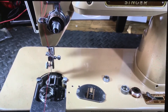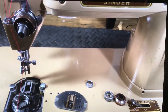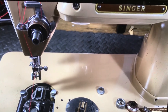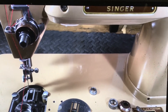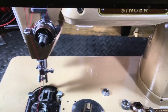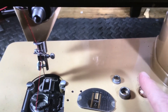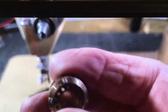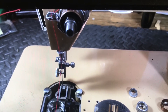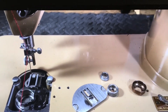The lady who owned this machine had been taking it to places and I'm not sure if they didn't know or were in a hurry. A lot of modern sewing centers — it's the grandkids working there now, not the grandpas and dads who were proud machinists and took the time to get it right. A lot of times you get a service and a month later it's doing the same thing again — it could be as simple as the tension vibrating down because nobody checked it. I'll calibrate it and always leave tension on four, which is the factory setting. Then I'll recondition the needle plate and put it all back together.